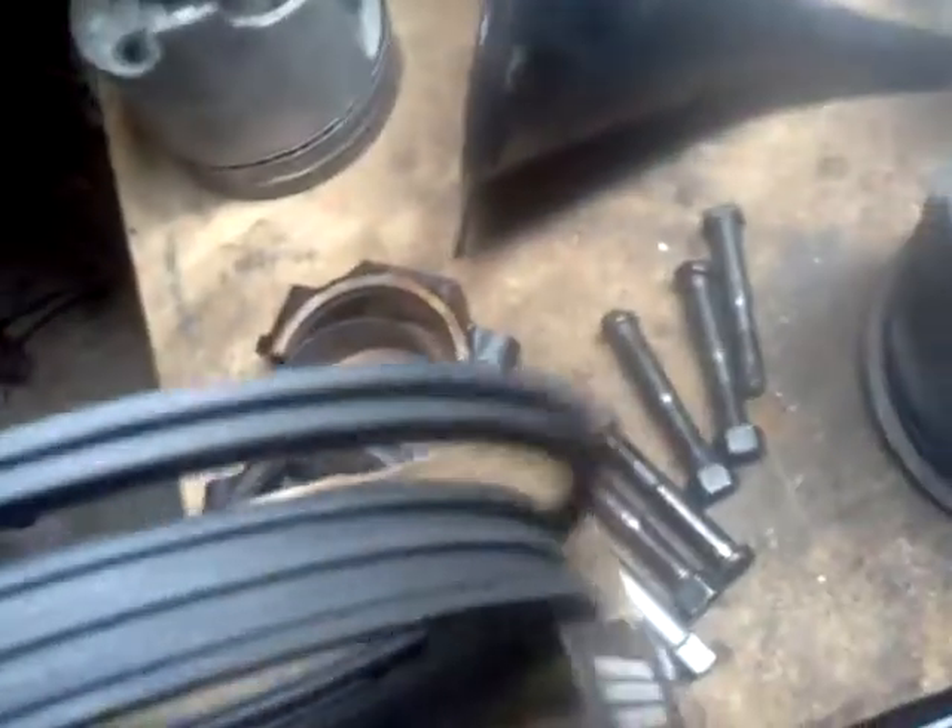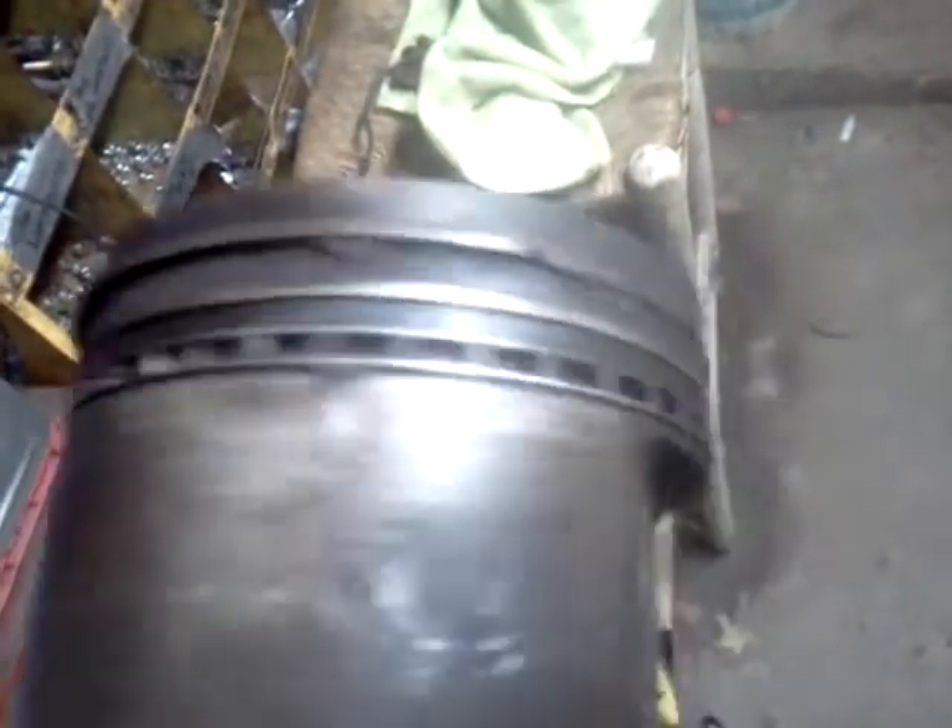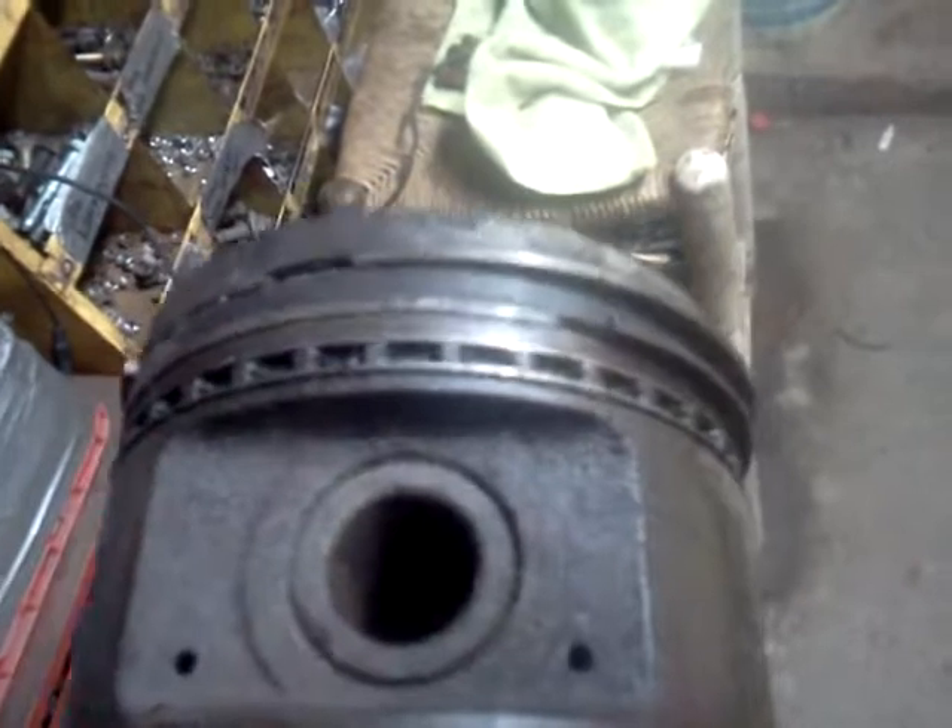Upper and then the lower. The rings were so stuck on some of the pistons I couldn't even get the rings out. It just sat up so long the rings are just frozen. So I got another 383 motor, and I got some pistons that the rings are not stuck on. They're the same bore — standard bore. Like I say, the cylinders are good in the motor.